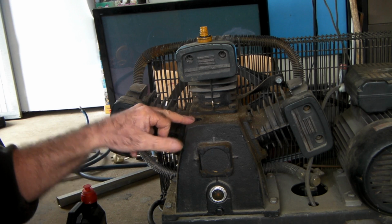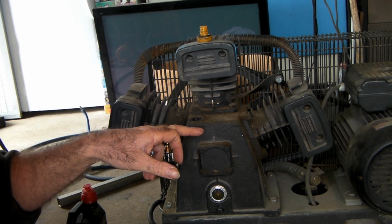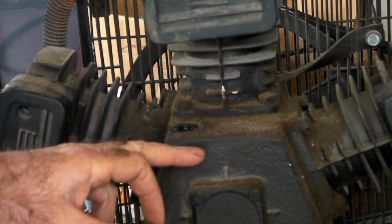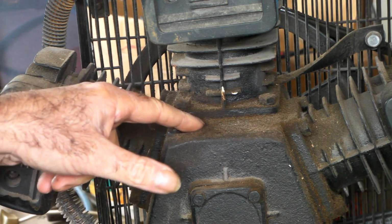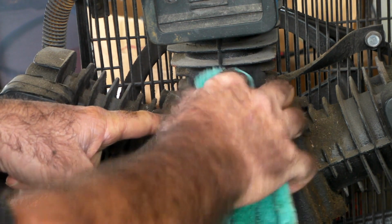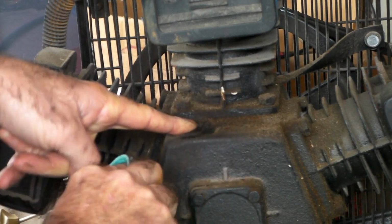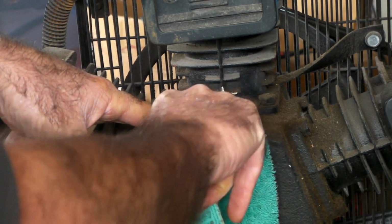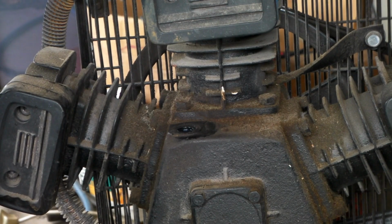So the oil fill is full of holes up here, guys, and as you can see, we're covered in all sorts of crap on here. So what I normally do is this. I'll get a rag or something, and I put my finger over the hole, stop anything going in there, and just wipe round where you're going to put the oil in, so you don't get contaminants into your pumping head, because that wouldn't really be a good look. Doesn't take much. There you go.